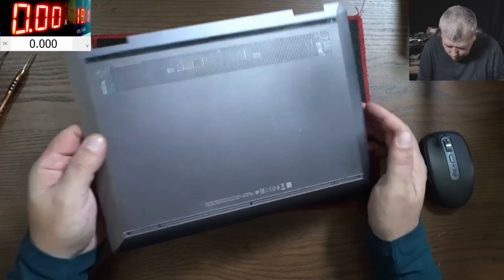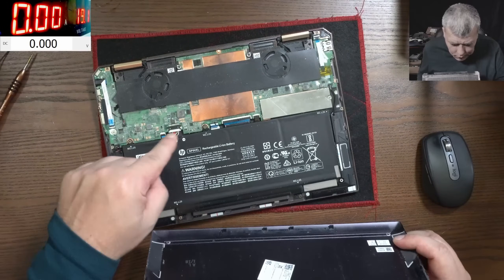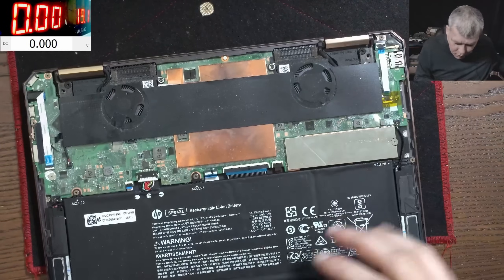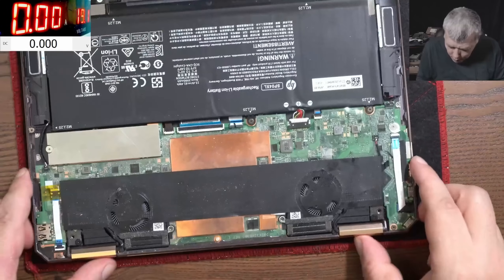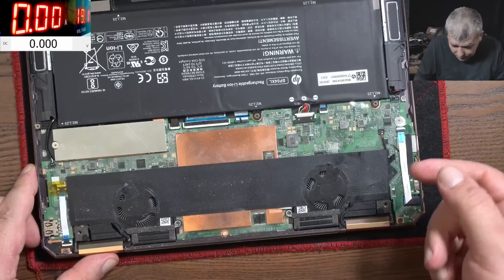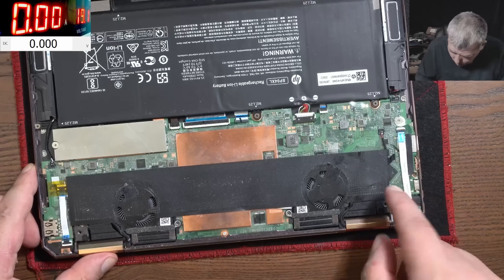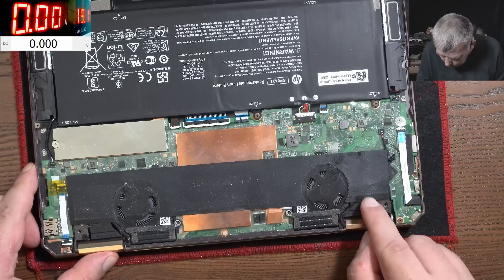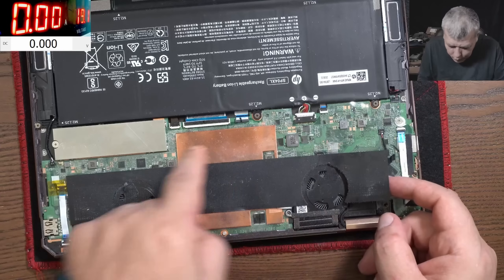The screws are out and this kind of looks untouched. Can you spot any fault or problem? I can't see liquid damage - you have a foil over the motherboard. It's a proper nice laptop, kind of slim for two fans. Here we can see some liquid damage, but because the board is covered in foil it's a low probability to be a liquid damage job.